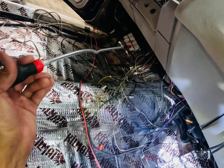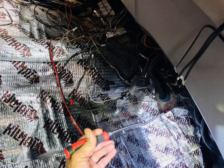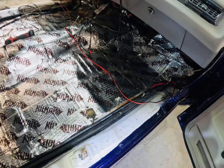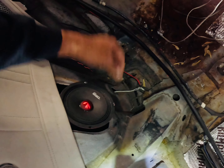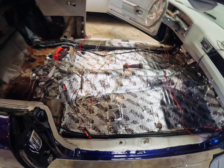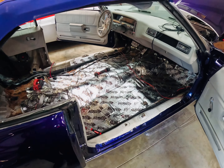And not even good speaker wire — I'm talking about that Walmart stuff. Ain't nothing wrong with Walmart, not bashing Walmart. But they want to get paid — people charge a lot of money to do this stuff. There's one screw in that speaker back there, one screw on this speaker here. I wonder why it's cutting off — because the positive is touching the frame. Installers need to take more pride in their work.